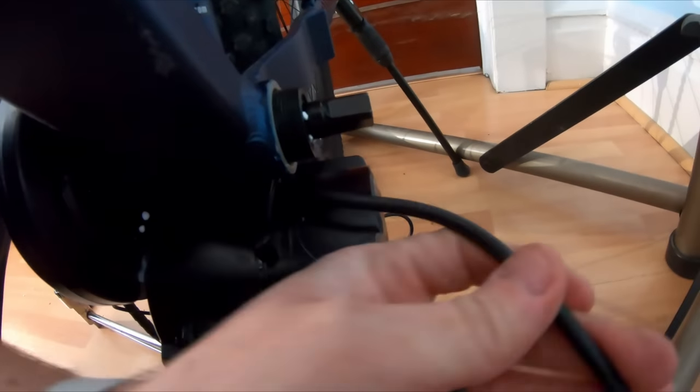At this point I'll install the display. This is the 500c display — I really like it; it's small, it's color, it's easy to install. I want to leave room for the throttle, so I'll put it right about there so the throttle can go right next to it. Snug it up a little bit — this isn't necessarily where it's going to live permanently. Run up this cable, connect it green to green. Just line them up and put them in straight — you don't want to bend these pins.